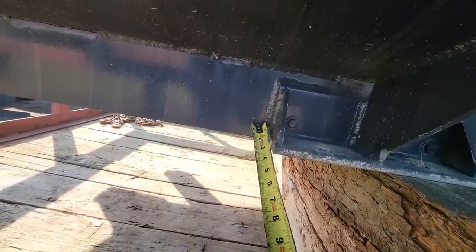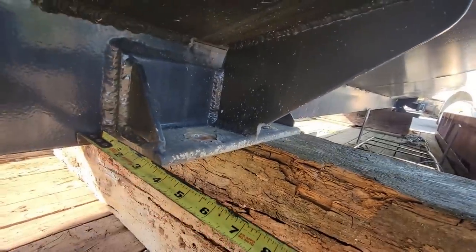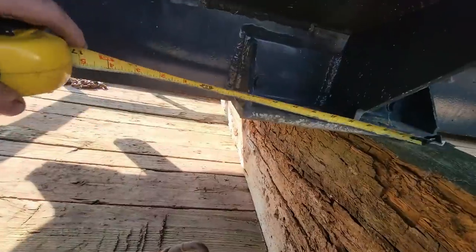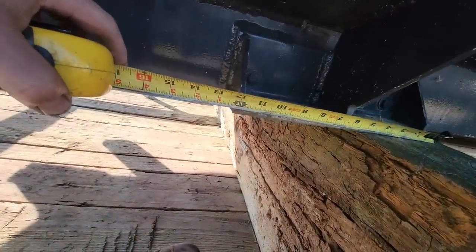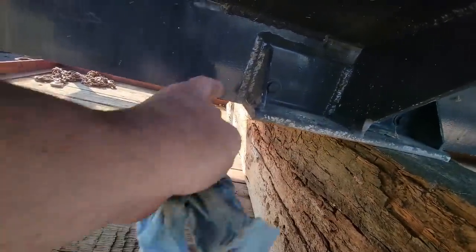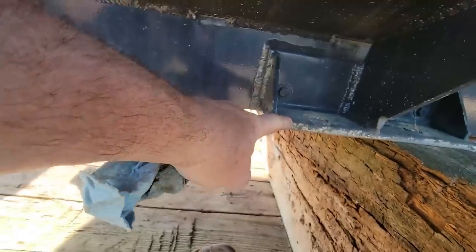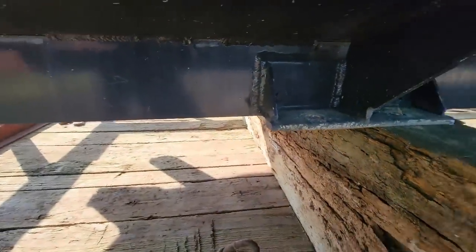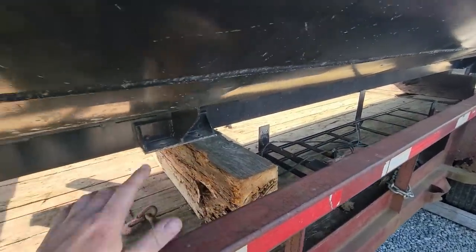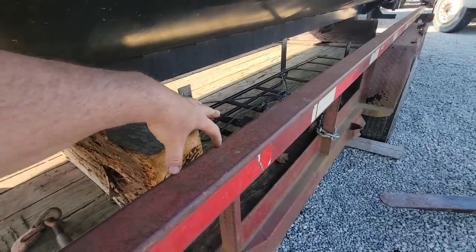And total, we're sticking out right about 3.5 inches. So if we're out 3.5 inches, and we are exactly 12 inches, I think I'm gonna leave myself a quarter of an inch each way in that saddle to hold that. So it'll keep it from going forward and back, but I'm gonna leave a quarter of an inch on each side, because I've measured these out and they may be parallel, but that doesn't mean that these brackets are square to one another, because it could be, you know, two of them could be a little farther forward than the other.